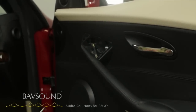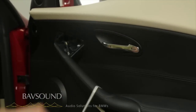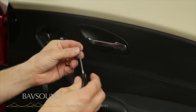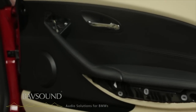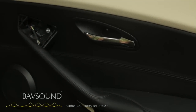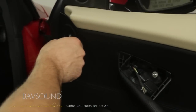We've still got a couple more little things we want to uncover. Behind your door handle here there's a little round circle. I'm using our right-angle pick. Be careful — you're not going to hurt anything, but you might leave a little mark. So you put the little tip of the hook tool between the seam, push in and it pops out, revealing another Torx T25.